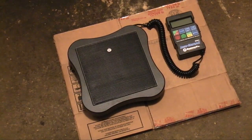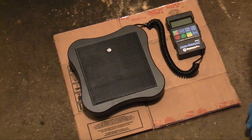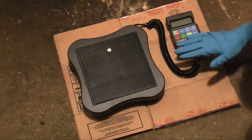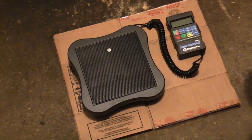As far as accuracy is concerned, the only way to put refrigerant in professionally is with a scale — a refrigerant scale. Bathroom scales aren't accurate enough. The problem with cans is the amount of refrigerant specified by the manufacturer isn't always the amount of one can, so you could put two cans in and then need three quarters of the last can and you're left guessing how much is left. With a scale, you zero it out and as the refrigerant leaves the cylinder it's indicated on the readout, and you know exactly when the right charge weight has been reached. Many people get by with disposable refrigerant cans without a scale, but too little refrigerant can cause insufficient cooling, while too much can cause system damage.